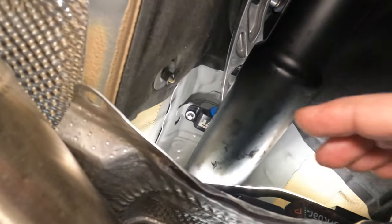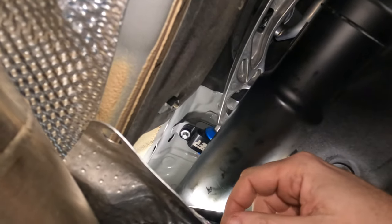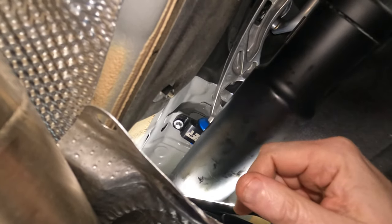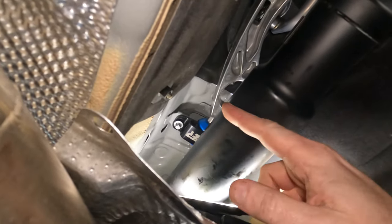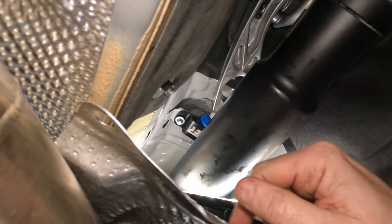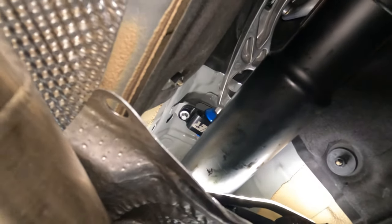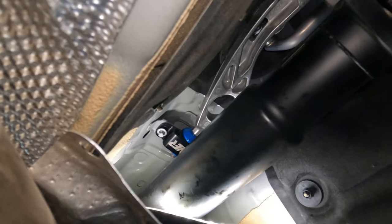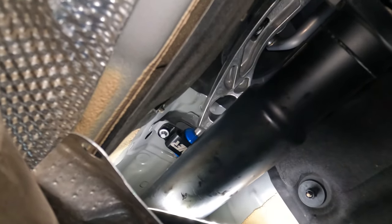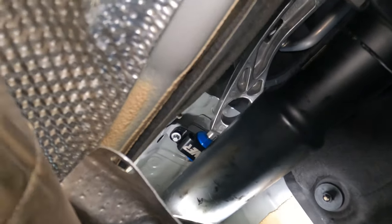As you can see, the bushing is in with both bolts in on both sides. When you reinsert the bushing, make sure to have a big healthy dose of high temperature grease on it — that'll be linked in the description. Just slide it up into place and make sure the holes in the new bushing align with the frame, then snug both reverse torx bolts back down. Note the beveled edge: there's a flat side and a beveled side. The beveled side goes towards the motor, on the arm side, while the flat side faces the back.